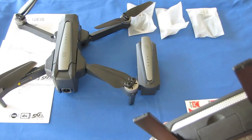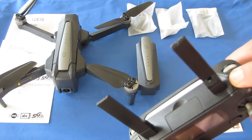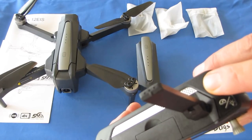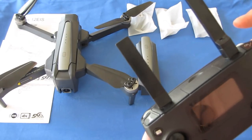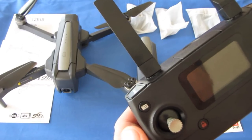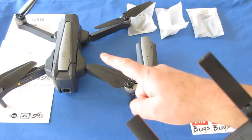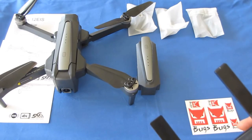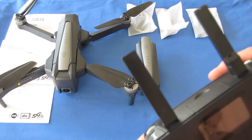Here's where the rates actually are — I take it back. You can switch between low and high rate by holding this button down on the right. The scroll wheel on the right is for raising and lowering the camera lens on the drone. The photo/video button takes a photo with a quick press, and a long press starts video recording. Always remember to stop that video with one more long press before turning off power, or you will lose that video — the file becomes corrupted.